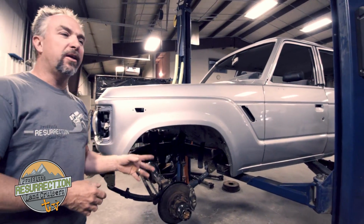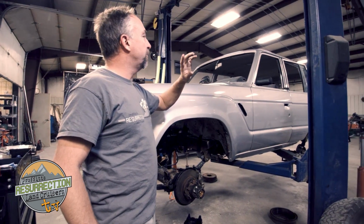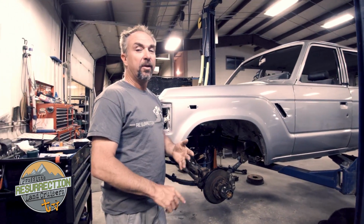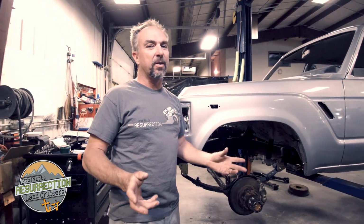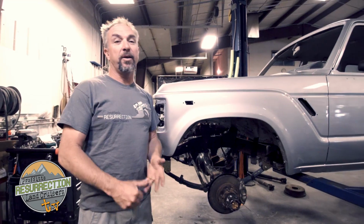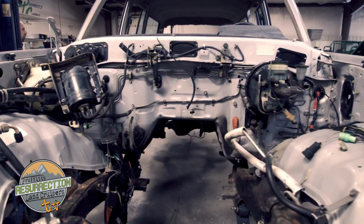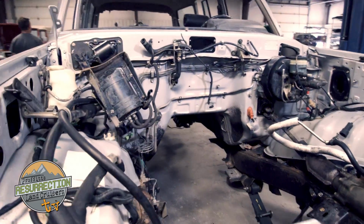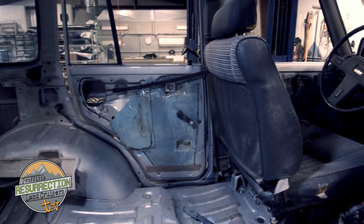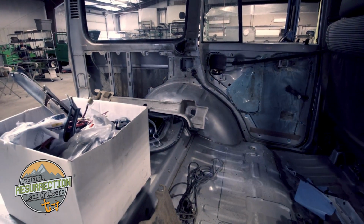This is Nick. Nick is a very lucky Land Cruiser because he belongs to a super cool customer who is going to do all of the coolest things to this Land Cruiser. This is a Stage 2 restoration, and we've already done the paintwork on it. It's not been reassembled yet, but you can tell that it's new shiny silver, and it's also getting a 2.5-inch lift and a brand new 5.3 liter Vortec and H55F 5-speed transmission. So this is going to be a stealthy Land Cruiser when it's done, and he's got some really good ideas for the wheels and the interior, and it's going to be super cool. I can't wait to get this done for this customer.